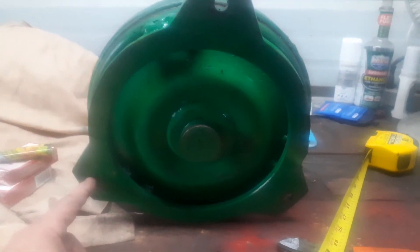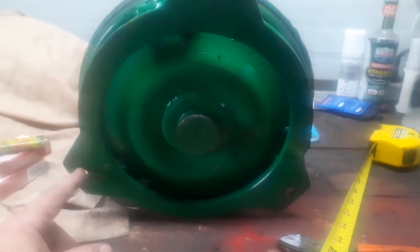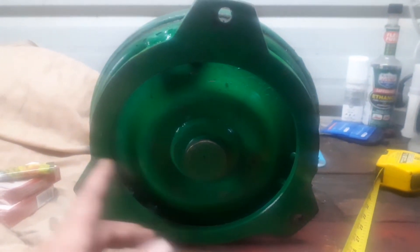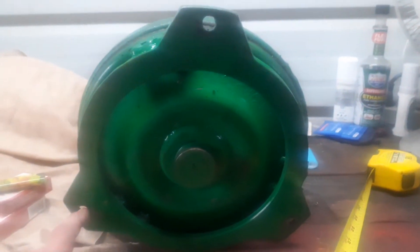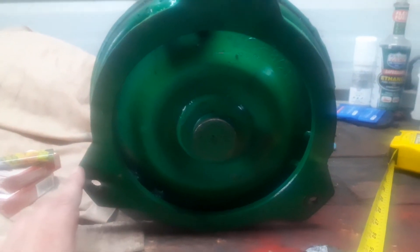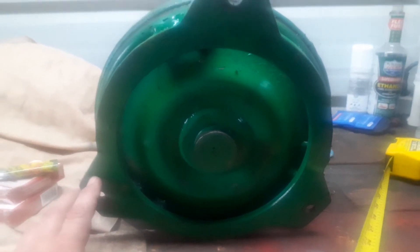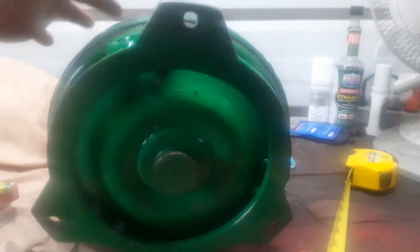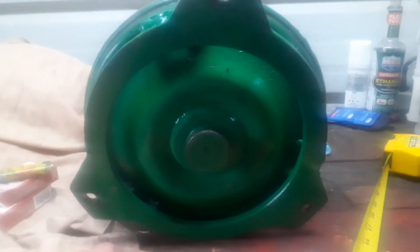This one only has one bolt hole in it. Some of these I have two or three that'll fit different sizes. The Turbo 350's bolt pattern is a little bit different than the Turbo 400. This is a Turbo 350 bolt pattern — I took it out of a Turbo 350 but I put it in a Turbo 400. The splines and stuff are the same but how it bolts to the flywheel can be a little bit different.